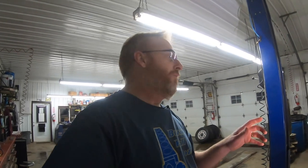So what we're gonna do tonight is we're gonna try and get that straight. We're gonna grind a little piece away from there so we can get some clean metal to weld to. We're gonna try and weld that stress crack open a bit and help keep that hood straight. We're gonna show you how we're gonna do that. Of course, this isn't something that you're gonna do on a freshly painted truck, because hopefully you've already fixed this problem before you've got to paint.